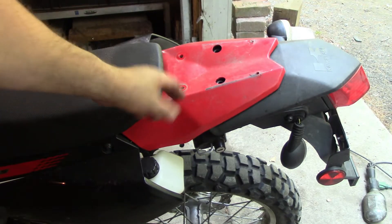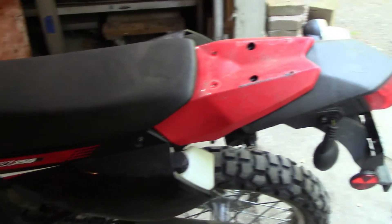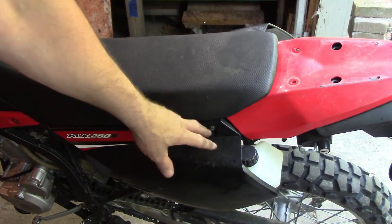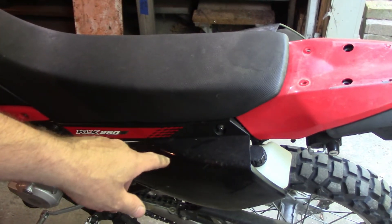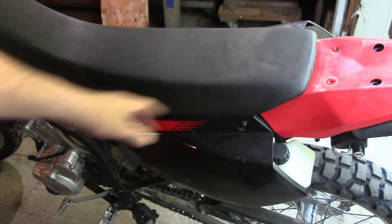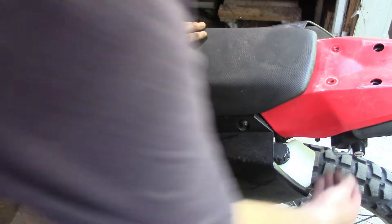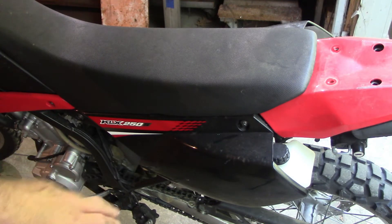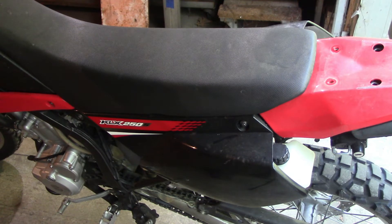Four bolts and you have to reach underneath to grab the nut - absolutely no help. Next thing is the seat, which is probably going to come off because there's probably something in here, and maybe these side panels too. The side panels have to come off because they're part of the seat mounting hardware. Both side panels are pretty easy - just 10 millimeter bolts. There's one, two, three bolts on each side.